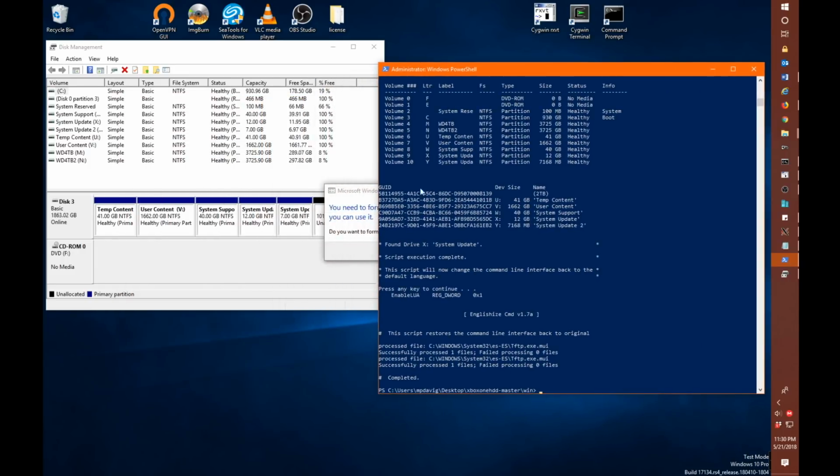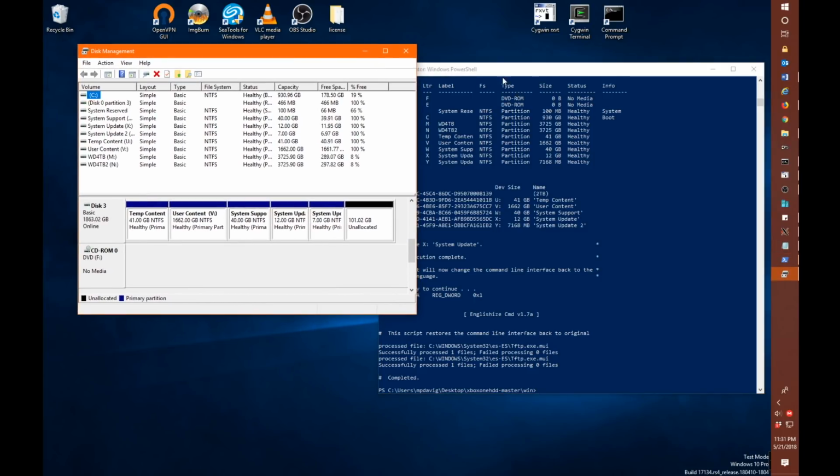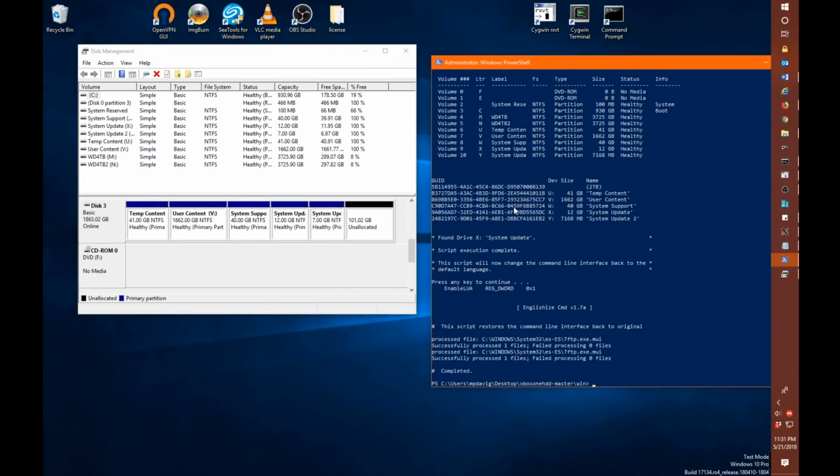And that's all there is to it in terms of building a new drive. And you can just close those windows, by the way, just hit X on them. You don't actually want to format your drive because the script does it for you. Now, one other thing I like to do, aside from inspecting that these came out okay, and as I mentioned, if this doesn't match correctly, you may want to run the script a second time. Sometimes, for some reason, it doesn't take the first time.